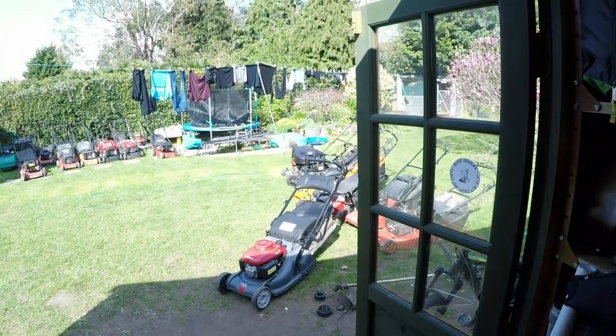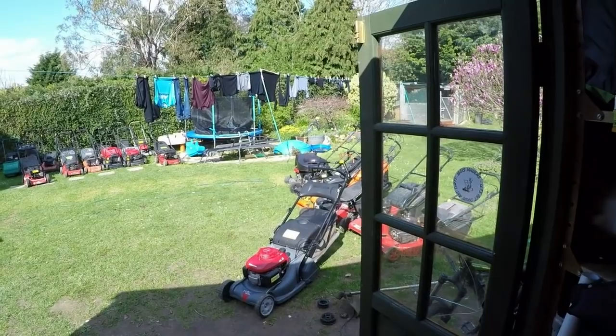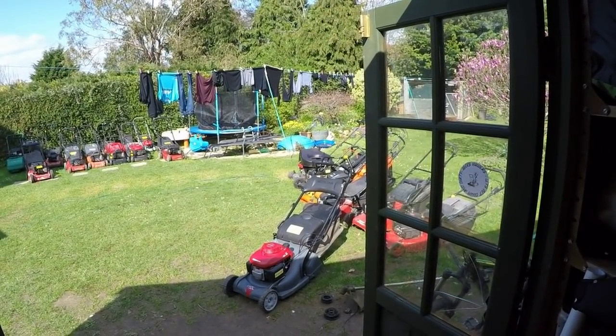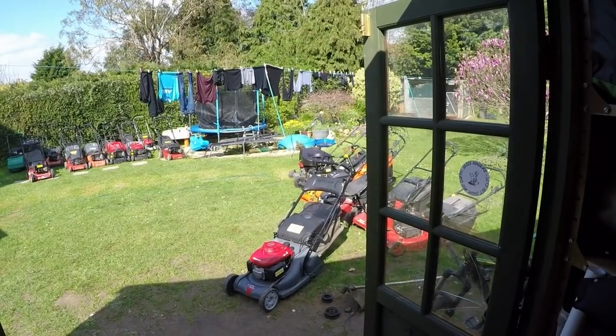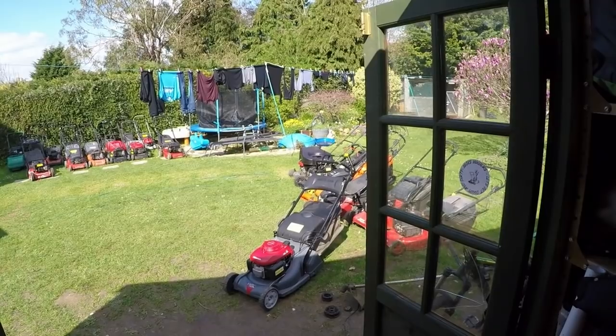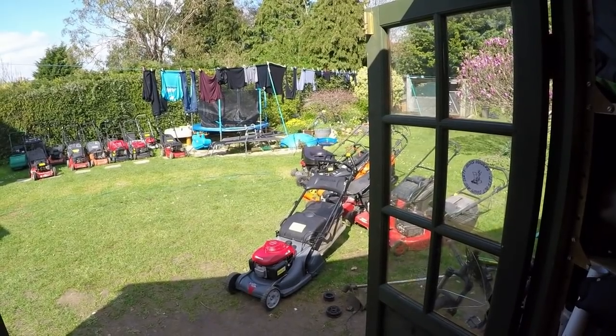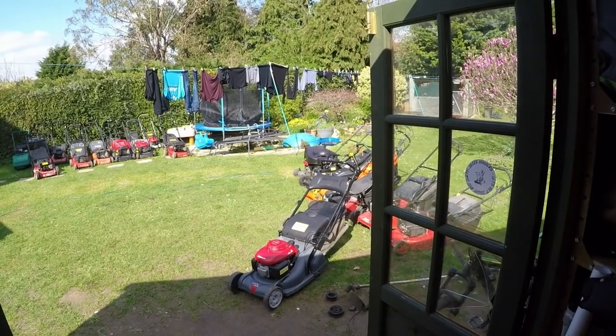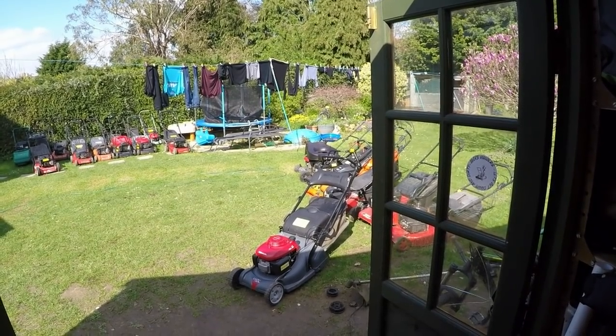Okay, so I've got that little body out there in the sunshine, that's now just drying off. I'm not quite sure how long it needs to cure, I'll have to read the bottle, but we've got absolutely brilliant sunshine today, so I don't think it'll take long out there. Once it's all cured off, I'll give it a little rub down quickly with just a very, very soft scouring pad or something along that line, just to knock off any lumps and bumps. And then we'll have it back in ready for a spray.